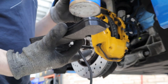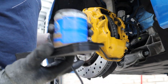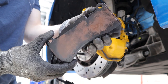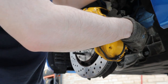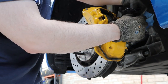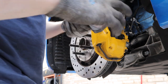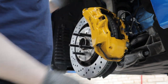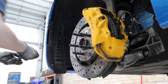The copper slip helps when the pads are really tight to slide them in, especially if you get it down the sides. These are fairly loose fitting so it's not going to be a problem, but it also helps to avoid a bit of squeal. Put it on the back where the pistons are going to contact the pad - doesn't have to look nice - and just a little bit down the sides. Sliding back in there - normally that is a bit of a pain because it'll be really tight, but I've got lucky here doing the brake pad change so early.